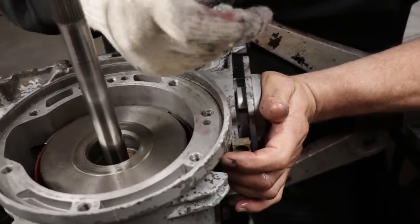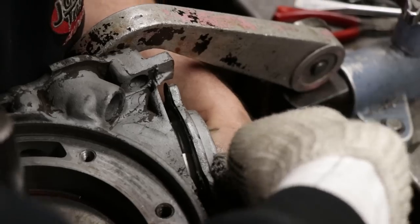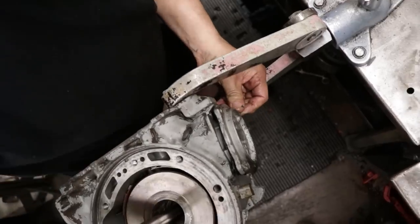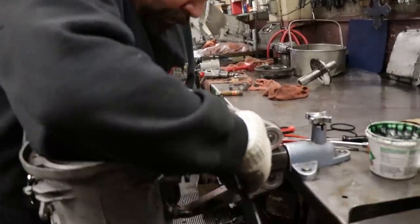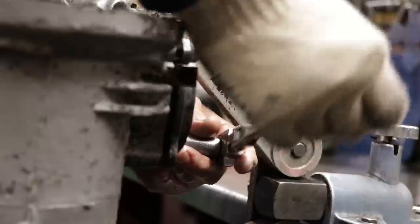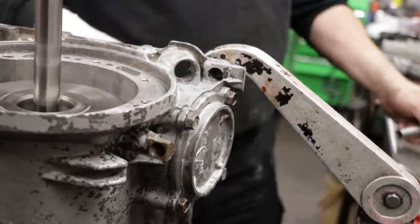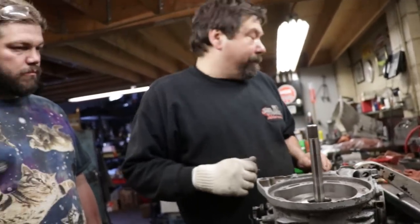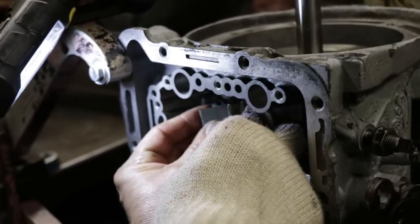Well, you gotta make sure that you get it started, because again, you don't wanna nick the rings, right? You always wanna make sure that it stays nice and square. So I'm actually gonna run that in by hand because I wanna feel how it walks in. You know, when you run stuff in with a gun, sometimes you just don't have the feel for it, eh? Yeah. Beautiful. Before we put the pump in and put the pump together, we're gonna put the strut bars on that front band. Those tabs keep the band from sliding on and off of these strut arms, right?